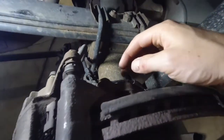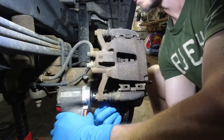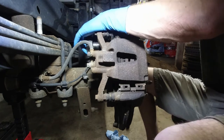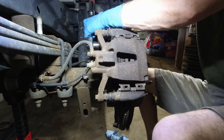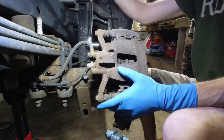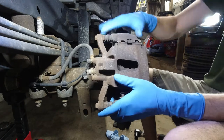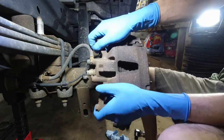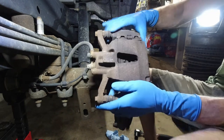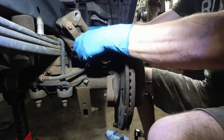So now it's only two bolts — 18s. This one here and one more on the bottom. You won't have to press the piston. Once you get this off a bit, you kind of tilt the caliper towards you, tilt this way, and this will compress that piston even more. So we're going to just rest this on top of the axle.